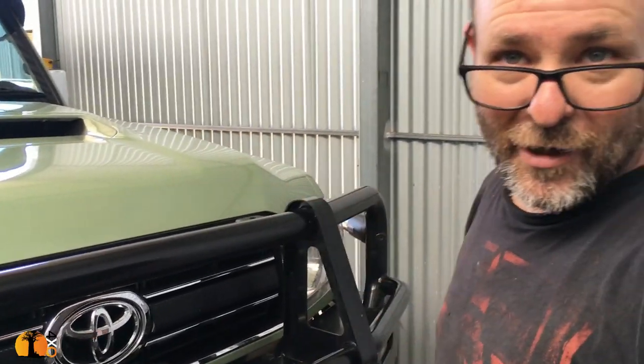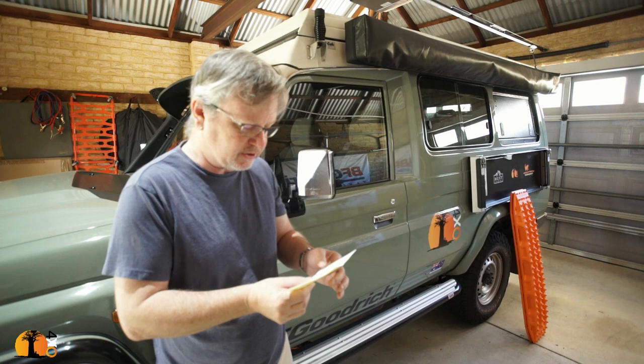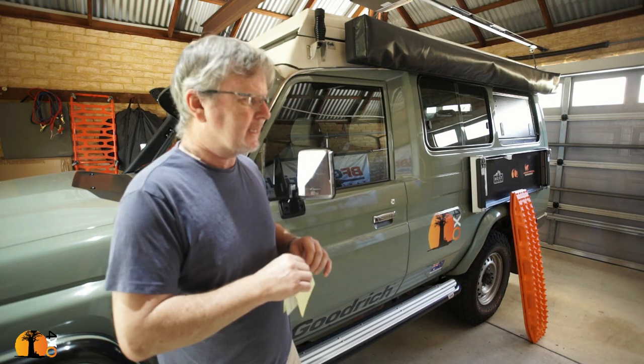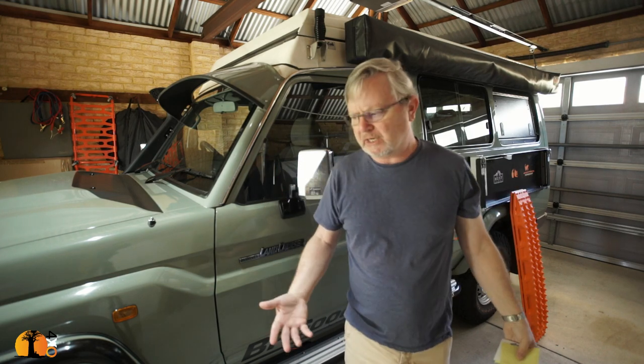And that's your front and that's your rear weights. Yeah, that's not too bad at all. That's actually lighter in the front than it is in the rear. Front axle weight 1,450 kilos. Rear axle 1,640 kilos. Total weight 3,090 kilograms. That includes 90 liters of fuel in the back tank, no fuel in the front tank, and probably 25 to 30 kilograms of stuff in the back. I took a lot out, but I didn't unpack absolutely everything. For example, I left in the tools, I left in the jack, I left in some stuff.